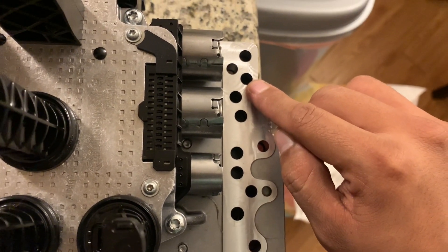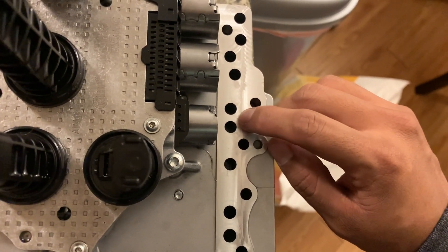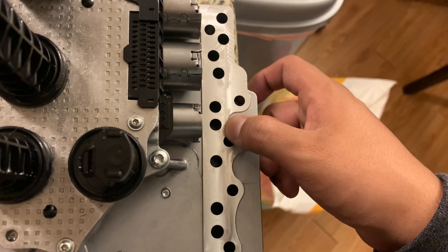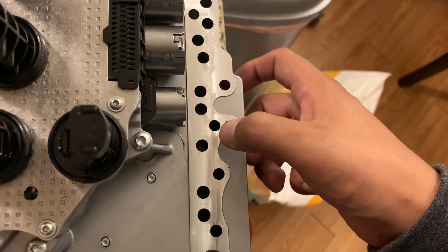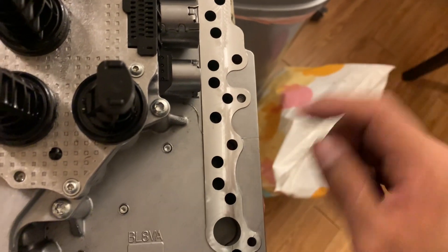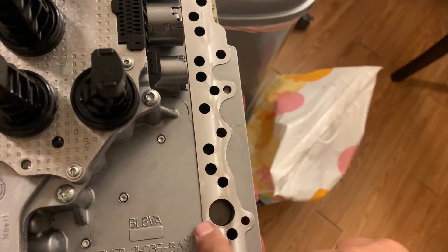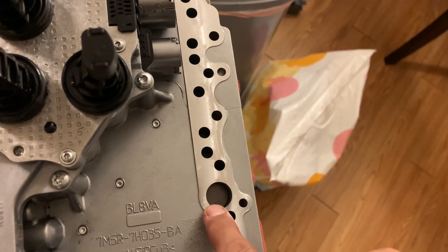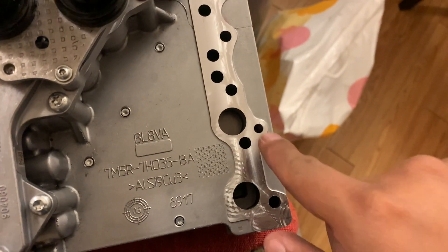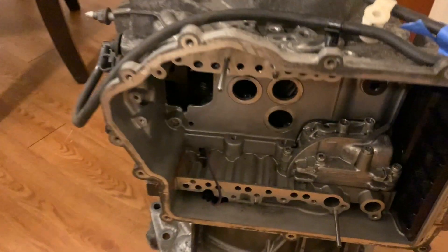This is the fifth shift fork, fourth, neutral. Then we have these two right here — this is the C2 clutch, and also the C2 clutch drum assembly, the lube, and the C1 clutch. Then moving down here we have the C2 balance and the C1 balance. And this one right here will be your pump inlet and also your pump outlet. This one is just a guide pin and will correspond to the same part of the transmission.